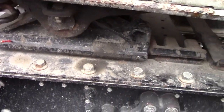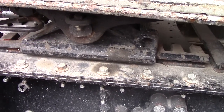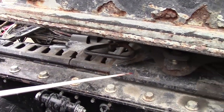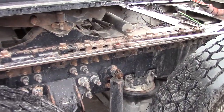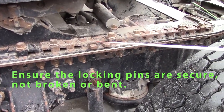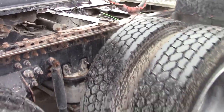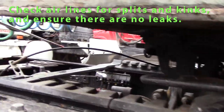I'll check my locking pins. This is a closed system — the locking pins are on the inside and lock into these grooves. That fifth wheel has an exterior locking pin system, but what you're checking for is that your locking pins are locked all the way into those grooves.